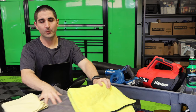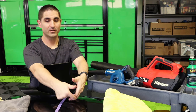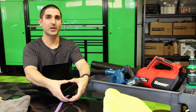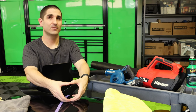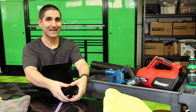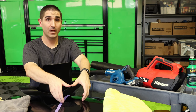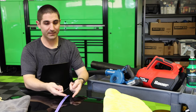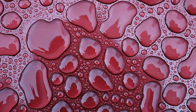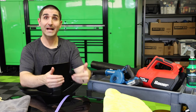Let me demonstrate. When you see a water bead on paint resting like this, you'll notice it's coming off — imagine a circular shape — the water is essentially not wanting to touch your paint. This is a good thing. Now, as the contact angle lowers, it will get more oblong and blob-like. If the shape of your bead looks like a lake or something on a map, that's not a bead. That's not good and it actually can cause issues.